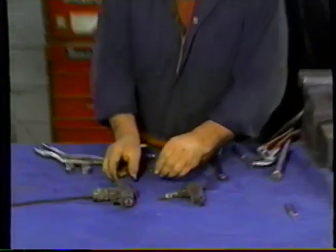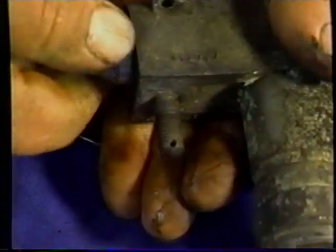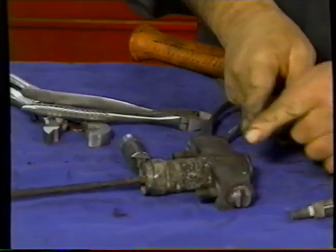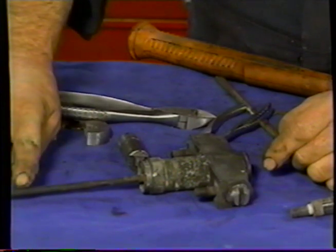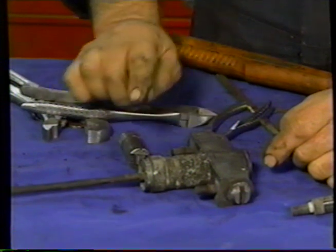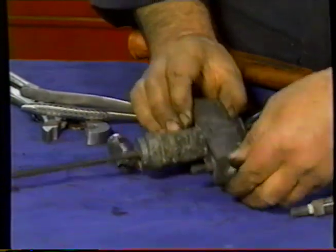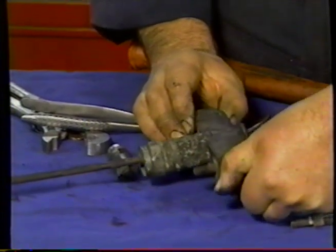What we're going to do now is we're going to pull these pistons out. I pulled on the rod, which pushed them out somewhat. You can see that the piston has a roller, and this is tapered, which pushes them out. And this, of course, is joined to the foot pedal and to the servo mechanism. So that the initial press of the pedal pulls these out, gives you a feel to the drum. And then the servo through the compensator pulls on them on a hard braking application. So we'll pull that one out as well.